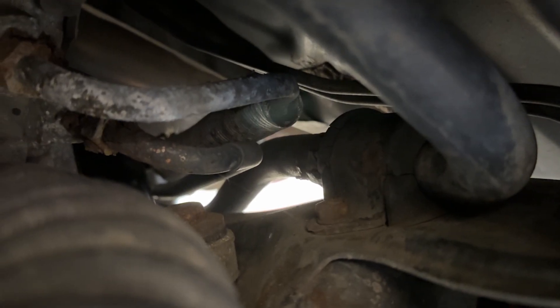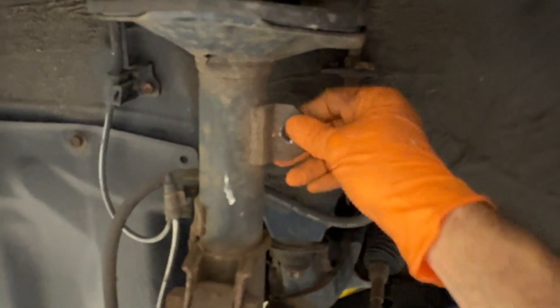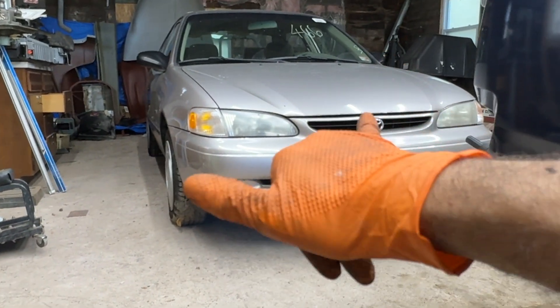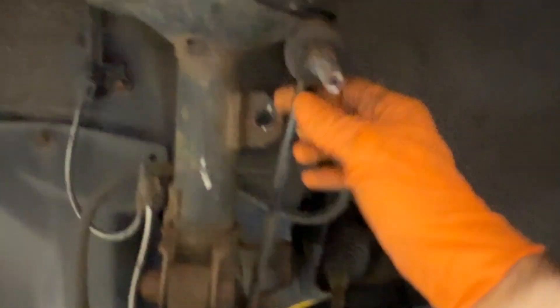This bar is connected to the frame right there — you can see that big metal loop. Right there, dead center of your screen, you can see that little slit in the rubber. That's how they manage the rotation. The bar, remember, is shaped like this — it can rotate all it wants, it just can't twist. And that twisting is what resists one side of the wheel wanting to go up when you're cornering. The bar levels the car back out. That's what a sway bar is and how it works.